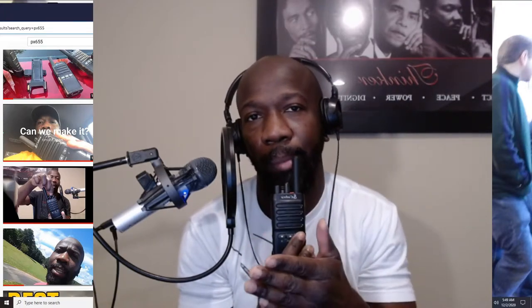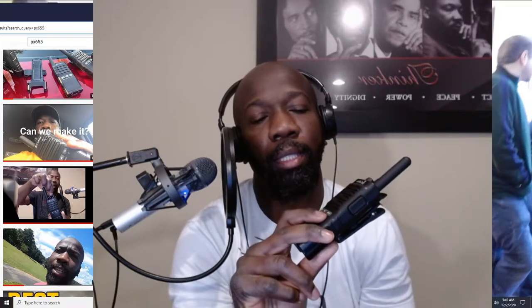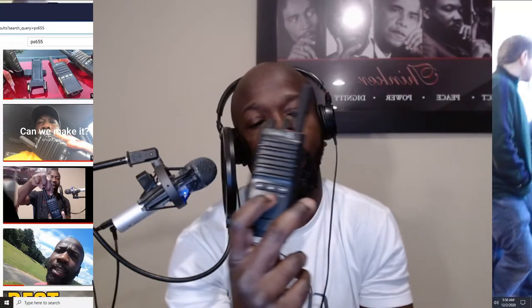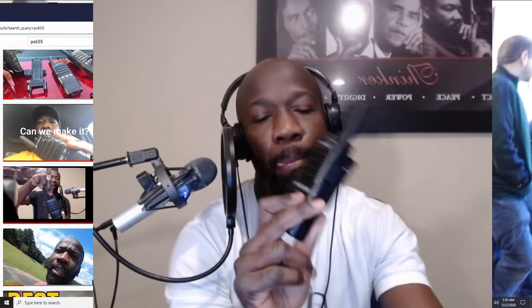We have the default privacy code set. Privacy codes allow you to communicate on a certain channel with an added code, which reduces interference from other nearby walkie-talkies. To change the privacy code, hold the Function button until it says 'channel code memory,' then use the up or down buttons to select your privacy code. Both walkie-talkies must be on the same channel and the same privacy code to communicate.